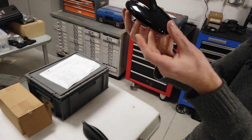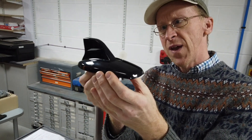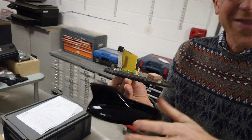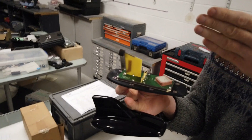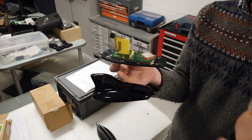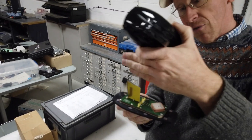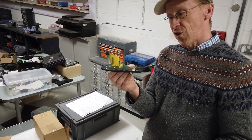Then they started to get a bit cool with this one. That looks proper like a shark's fin - proper aggressive. And it is very fin-like. Dorsal fin - is that what they call it? Yes. Now, this isn't purely just to make your car look like a shark. It is because you do need to have a vertical antenna. I'm going to guess that this is perhaps for the radio, TV, or phone - GSM. The GPS one is going to be looking up more. You'll notice there are elements at different planes, 90 degrees to each other. So this is all to do with aerial wizardry - it's not just to look like a shark, it is to house a vertical aerial.